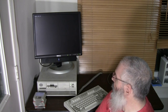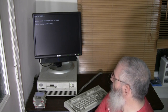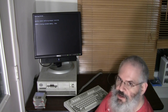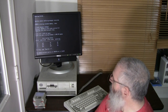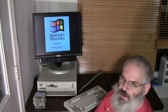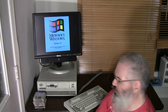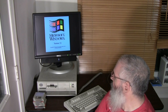Hopefully you can see that on the screen — the machine is checking memory. One of the differences between IBM PS/2s and contemporaries at the time is that the memory test is not skippable. We see the machine starting up MS-DOS. It has MS-DOS 6.22 installed on it currently and Windows 3.1. We are attempting to start Windows. Windows being on this machine is not so unusual — a lot of these machines, even though sold by IBM, would have been sold with DOS and Windows. Although it's certainly not MS-DOS 6.22, which was not out in 1988 — it might well have come with PC-DOS.